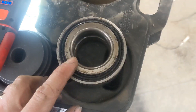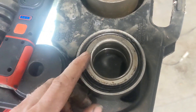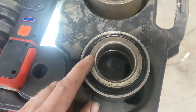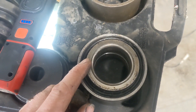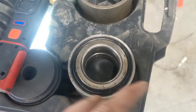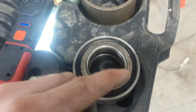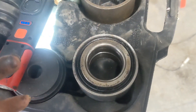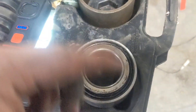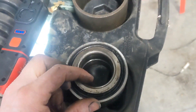There's not enough magnetism to cause a good solid signal on that wheel speed sensor. If you run live data diagnostics, the left rear speed sensor is nice and smooth and follows the speed of the car, while this corner is very jagged. It does register a speed close to the car speed, but you can see it's very erratic, bouncing up and down around the actual speed.